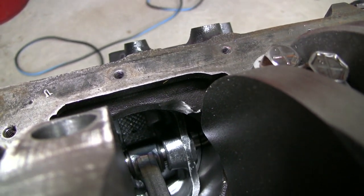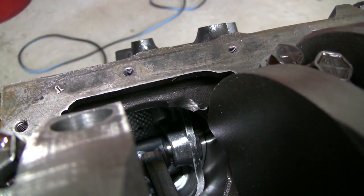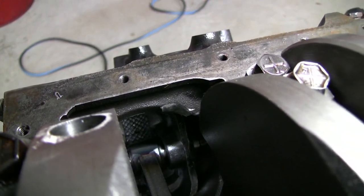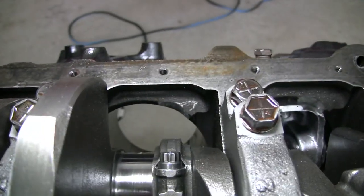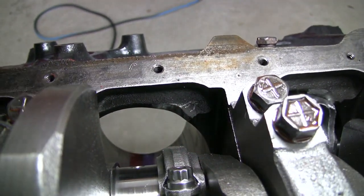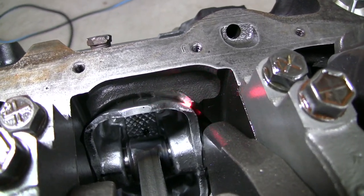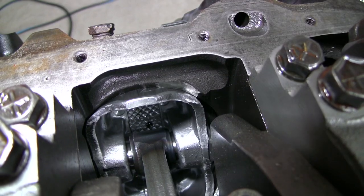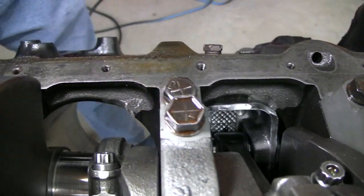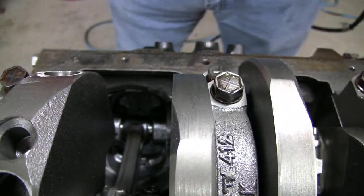I'm going to spend a lot of time checking the clearances on this crank and this crank block. There's been a little bit of grinding - you can see it right here with the laser pointer - but there's very little grinding, very little clearance grinding. Let's look at another area right here. Just a small amount of grinding. So I'm not sure - I mean it's run, it hasn't come apart - but I'm just not sure there's enough clearance for the rods and everything else in here. We're going to take a real close look, make sure the rods and everything clear, the crank and everything clears the block, clears the camshaft. I'm going to drag out the big feeler gauges and measure everything just to be sure, because I'm not real confident in this guy's building skills.